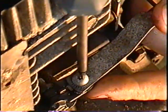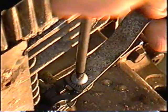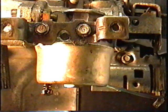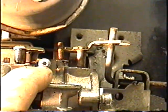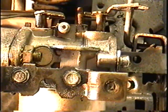There's a little nut under the screw that tightens it — make sure it's tight, and you always want a bit of play like that. This is a non-adjustable carb on this engine except for the idle adjusting screw, which has nothing to do with the internal settings of the carburetor.